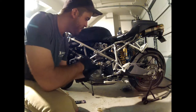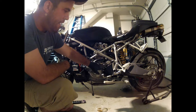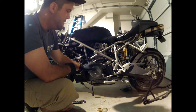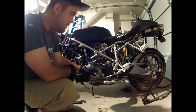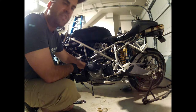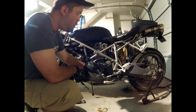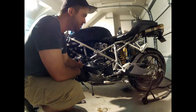And the old cylinder is off. The way the clutch is actuated is fluid moves into that cylinder, pushes out on this rod, and then that separates the clutch plates on the other side. If you're watching this and you do not have a 749 — if you have an older superbike, and I believe it was a mid-year transition in 2000-2001 — this rod on this bike is longer. On the shorter bikes there's an extension that comes with a lot of these kits, Oberon included, that you need to slip into the body of the new slave cylinder. We don't have that situation here, so I'm not going to be doing it, but be mindful of it if that's your situation.